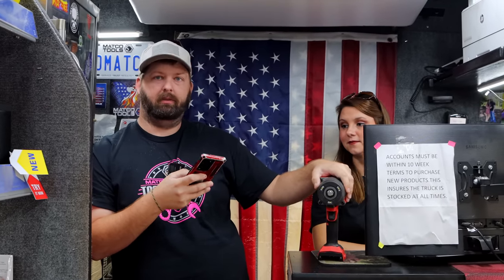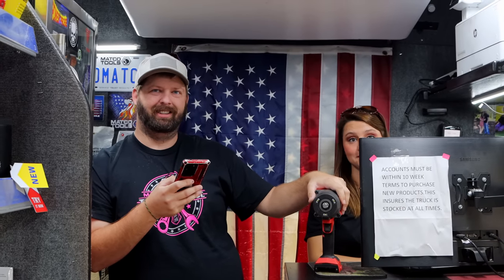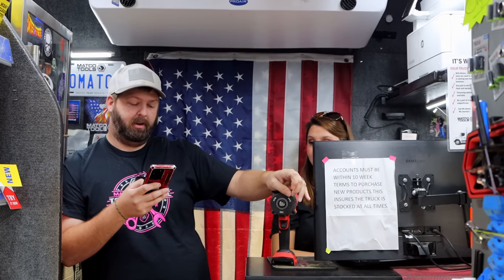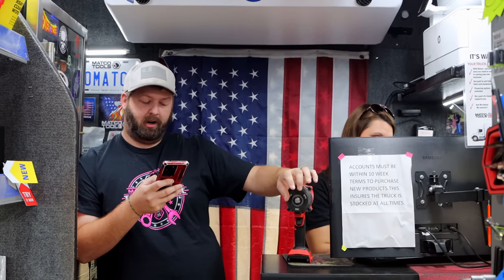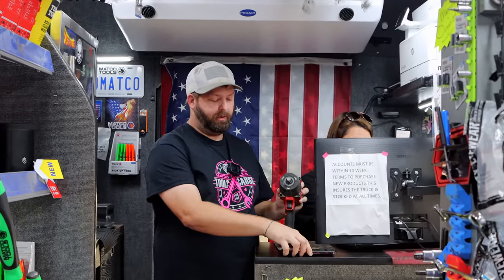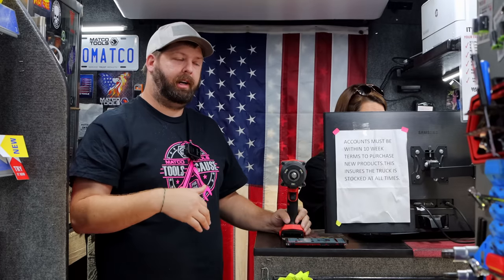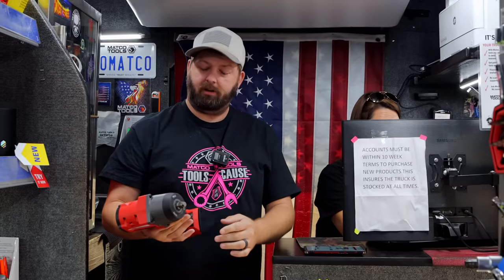When taking any other bolt out, yeah, wide open. But on lug nuts, if you're not careful you'll scratch a brand new rim pretty quick, or drop them. As far as RPM goes: first mode 0 to 700, second 0 to 1,300, third 0 to 2,000, and that last one depends — forward 0 to 900, reverse 0 to 2,000 or 0 to 750. It does have 1,600 foot-pounds breakaway. I'll throw in a disclaimer: that's 0 to 1,600 if you use their forged battery. If you're using older batteries, it does drop back down. Still industry-leading, but worth mentioning.